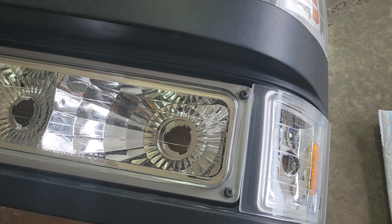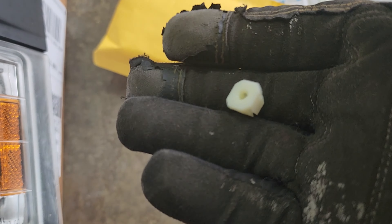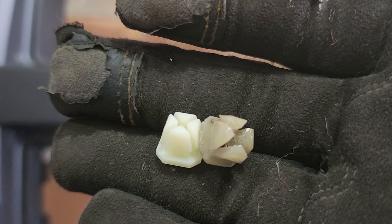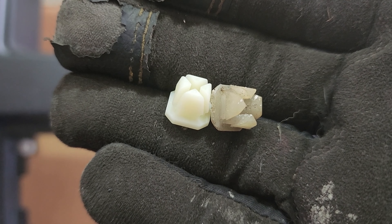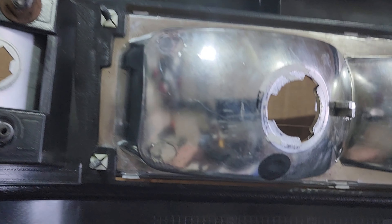Next is just me being a perfectionist. Behind these four screws is a plastic nut — I got a kit. I'll share with you the kits that I use if they work. And then behind these side marker lights are PAL nuts. Here's a comparison — old and new. The new ones should work; the old ones are very brittle. So I'm going to put these new ones in and hopefully they'll stay snug for a long time. All four new ones are in and all the lights tightened up real nice.